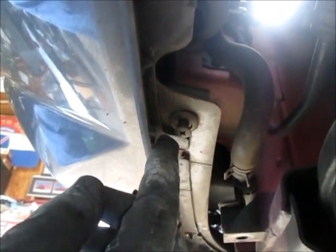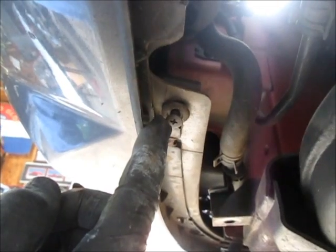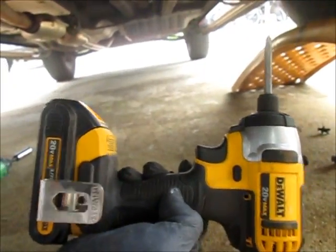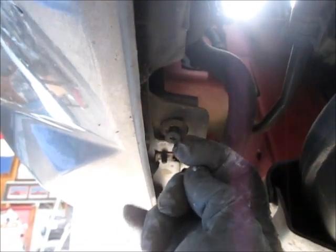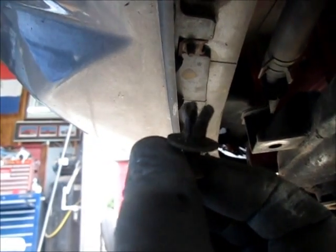There's one. Sorry. And they look like a screw, but they're really not. It's just a plastic push pin with a screw head, and it will turn, but it is a little tricky to get to. If you take a drill driver or screwdriver with a tip on it and turn it counterclockwise, it'll probably spin, but it may not come out. So sometimes you got to hook a little screwdriver behind the edge there while it's turning, or wedge a screwdriver in behind it and push that out. And once that comes out, you can see all it does is spread that end when it locks it in.